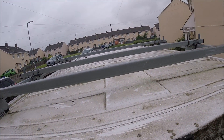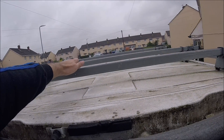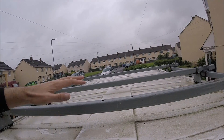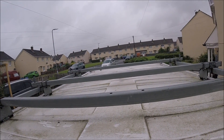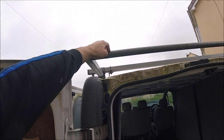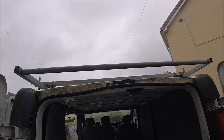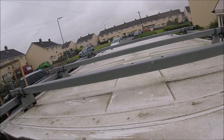I'm going to give the roof a really good clean down. I also need to remove this roof rack. I was thinking of possibly mounting the panel on top of the roof rack, but it's pointless because you wouldn't be able to use the rack. And if I left the rack in place and put the panel beneath it, anything on top would leave the panel completely useless — any shade or shadow on a solar panel basically knocks the entire panel off. So I'm going to remove this entire rack and probably put it on Facebook Marketplace to recoup some money.